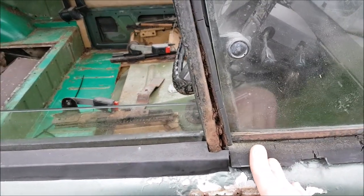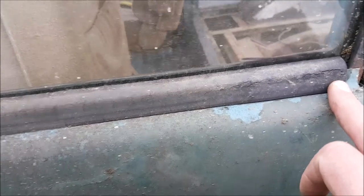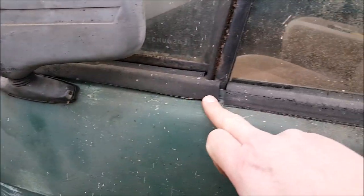Interestingly, what's happened here is we've got a much later rubber trim, early rubber trim. Again, it's not uncommon to see rubber trim messed around with on these cars. This is the early style. So you end up with a piece of trim that goes up to there. Whole quarter light rubber is part of one moulding, okay? And then this piece is separate on the inside and the out. And then there's a closing piece that goes at the back to cover over that untidy bit.